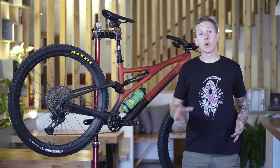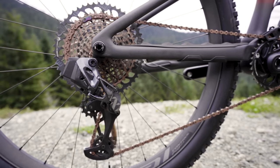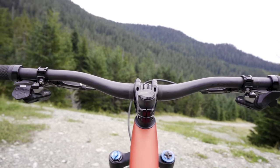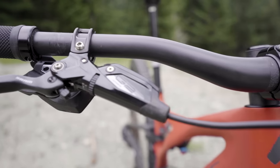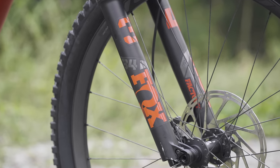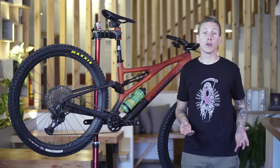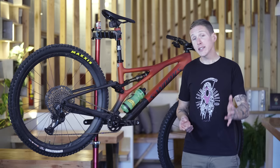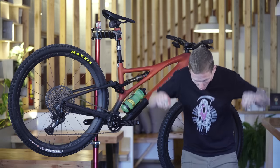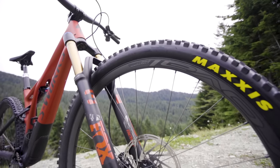Component highlights: this is an S-Works bike so it comes with high-end stuff, including an AXS drivetrain that was absolutely flawless during my time on the bike. I love how clean the cockpit looks with matchmaker clamps — only one clamp on each side of the handlebar, a brake hose on each side, and nothing else. It also comes with a Fox 34 fork with a Grip 2 damper. Lots of trail bikes come with a Fit 4 damper that gives a three-position pedal switch — if you like to get out of the saddle a bunch or do some racing, you might prefer that. The Grip 2 is much more adjustable and offers more performance, but doesn't have that pedal assist switch.